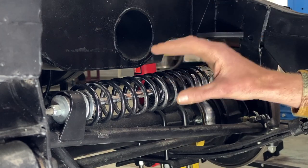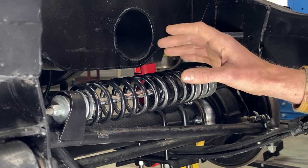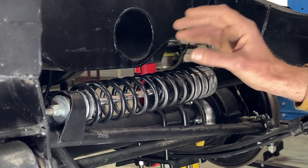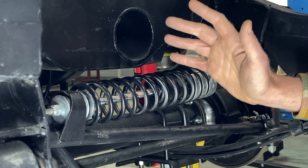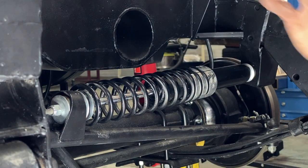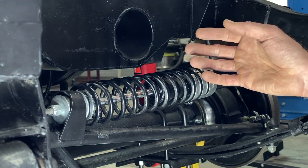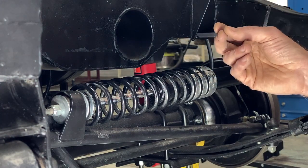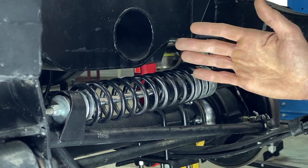But with it, it allows it to feel not like a modern car, but still like a solid axle, leaf sprung vehicle. But it steers in a predictable way. It tracks true. It tracks straight ahead, and it naturally eases the car back to a straight ahead position after you've turned a corner. So it's less of a learning curve, and there's less mental overhead constantly thinking about keeping the car pointing straight ahead.